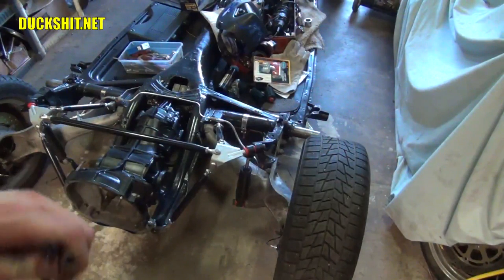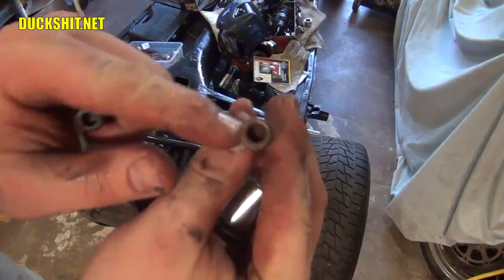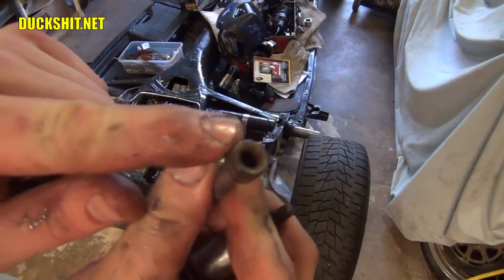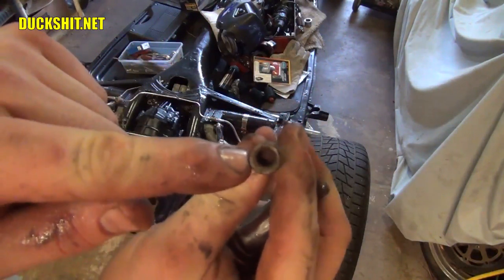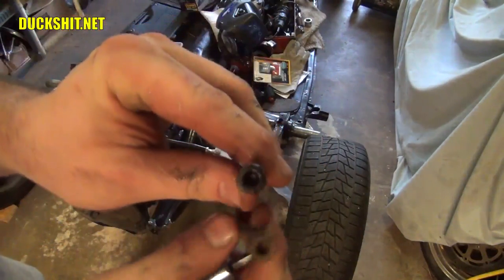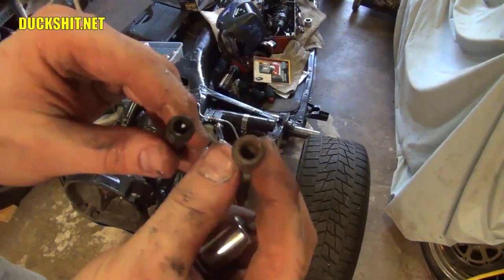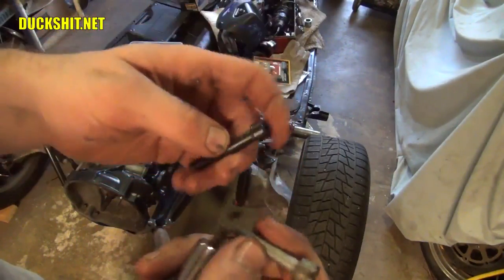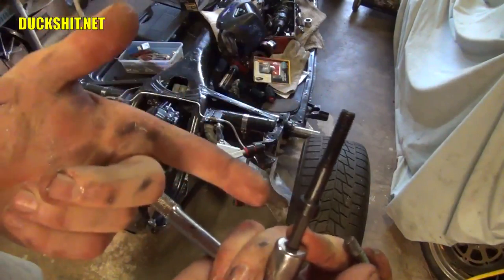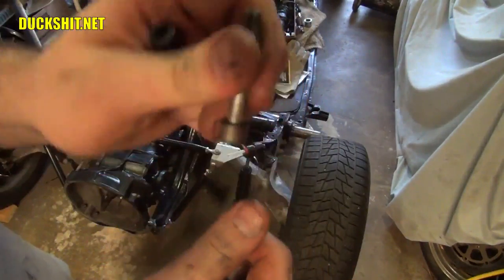Okay, it's time to get that axle mounted. Now, normally, Volkswagens use a 12-point bolt. It's actually got 12 little points inside of there, also known as a triple square. The typical 6-point, which is the bolt I was given to replace, and these came in the kit, is not the same as a 12. This requires a very different tool. This is not a typical Allen key, and while that may fit, if you put the 6-point in there, you might and probably will strip it out.